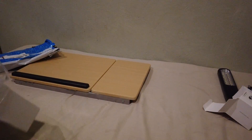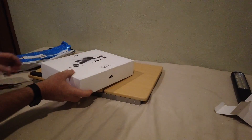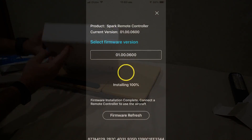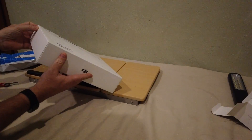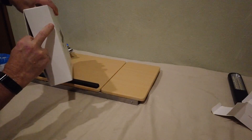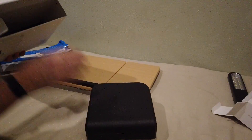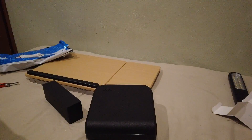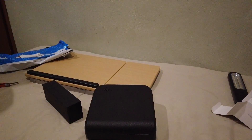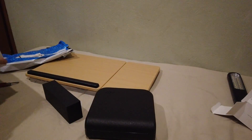I went back and Googled to see if there was a quick and easy fix. I read everything I could about IMU failures, error 71, and tried everything — checked the firmware, restarted everything, tried multiple SD cards, multiple batteries, multiple locations in case of interference or uneven ground. Still got the same error every time. All I read in the DJI forums was DJI staff saying to send the Spark back for repair or replacement.